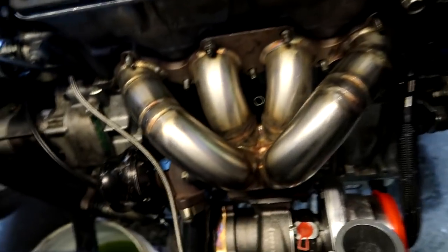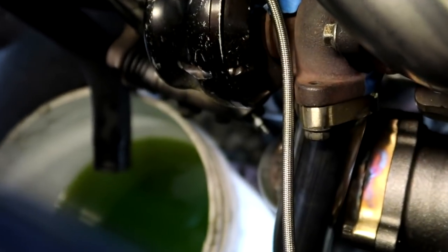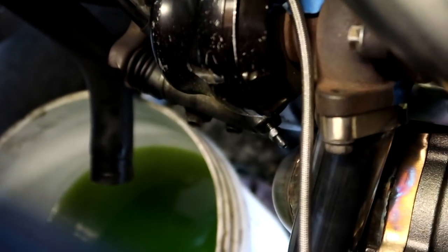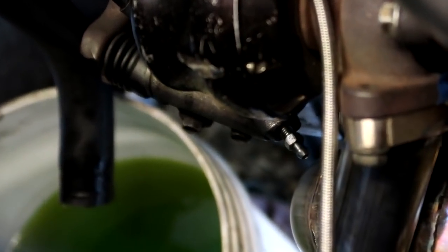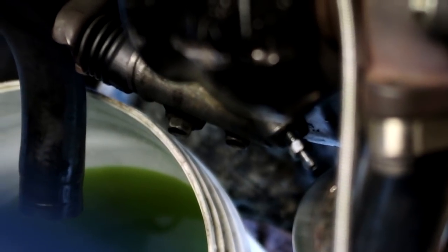Check this out, guys. That precision measurement right there. I had hit this fool up and told him, hey, send me some pictures of your motor to your radiator to your slave cylinder to ensure that when I made this downpipe, it was gonna clear. And we have maybe half an inch. And if you look way down there between the downpipe and the block, that clears too.